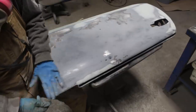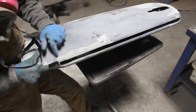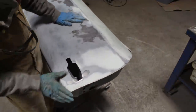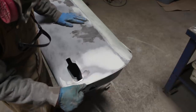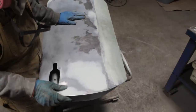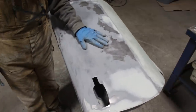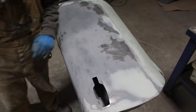This is not low here, it just needs more sanding. Here it needs a little bit more here, and here we are pretty good, except for this edge where it's a little bit low, and here we are fine. So not that much required, actually, just a little bit. I'm happy with the higher part of the door. So I'm gonna put body filler here, and we're gonna go back to the lower area.